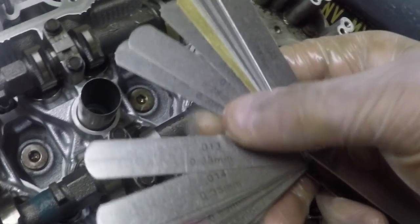I'm going to write on my box '806' — that's what I need for that one. I do have a thousandths of wiggle room for these, but I'd rather be a thousandths bigger because when this all heats up it expands — basic physics. For my exhaust side it is 0.30 millimeters.